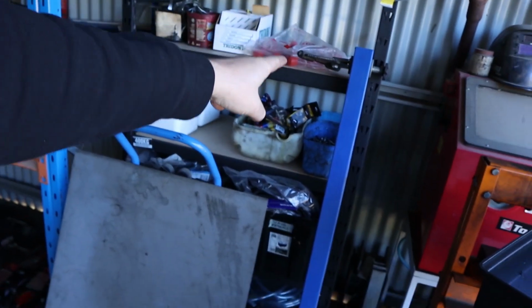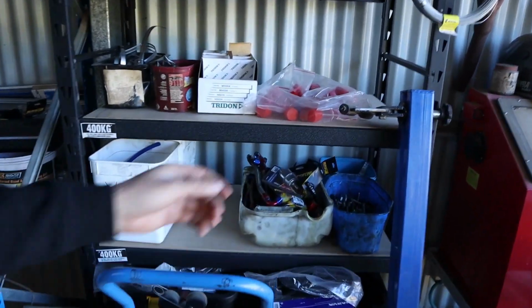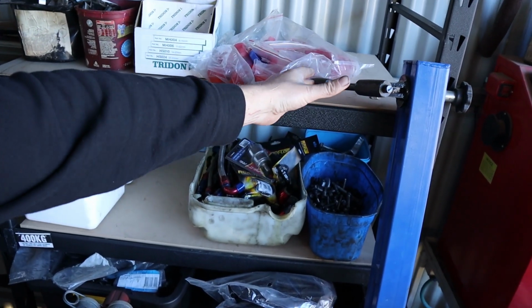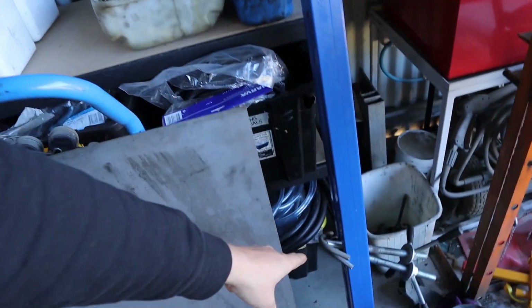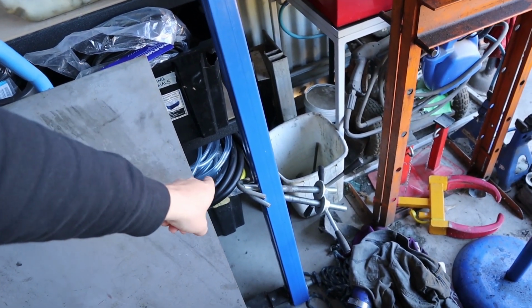Now we do a lot of cam kits in car because it saves a lot of cost. It's one of the ways that we can do cam upgrades quite cheap and do a complete cam package in car. But what we have is one of these. Now this is a special tool, and these pads sit in your bonnet sills. And what that allows us to do is sit that bar in your bonnet sills with these, as you can see, they're like big wing nuts to jack, so we can sling up your engine by the engine mounts, jack that up, hang your engine off this bar across your bonnet sills, and then we can actually remove the entire front cross member from the car to remove the sump.